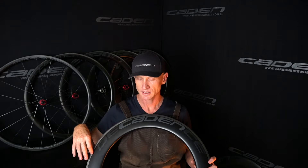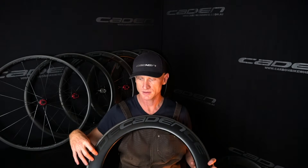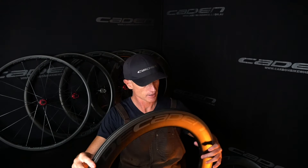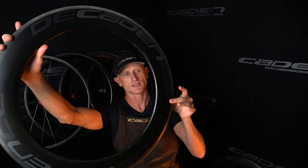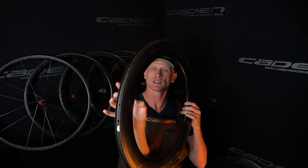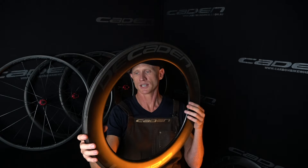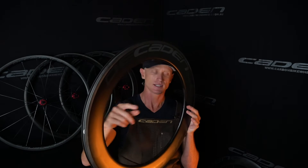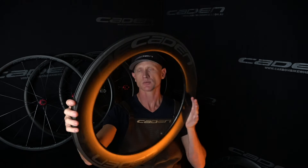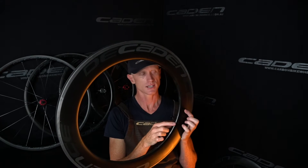To make sure that it's an elliptical shape, the front half of the wheel behaves similar to the back half. The old V-shapes in deep dish wheels caused a lot of problems — this half of the wheel effectively going from very thin to thick, the opposite of what you want on a plane wing. But this area here was thick to thin, which is what you do want. This blunt area allows the wind to come around both sides. You're actually losing a tiny bit of aero on this side to gain a lot of aero on this side.